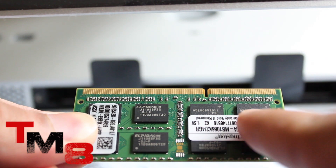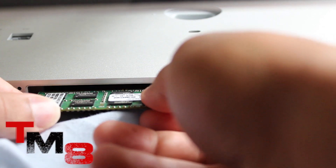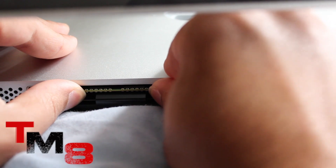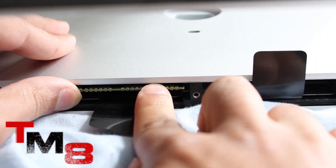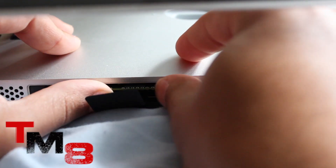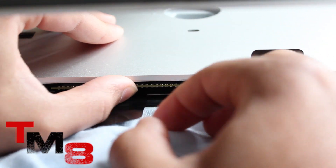The way you're going to insert your RAM: the smaller part goes on the right side. With the smaller side on the right, insert your RAM into the iMac. Make sure it is all the way in — you can tell because the RAM must not move and should stay in very solidly.